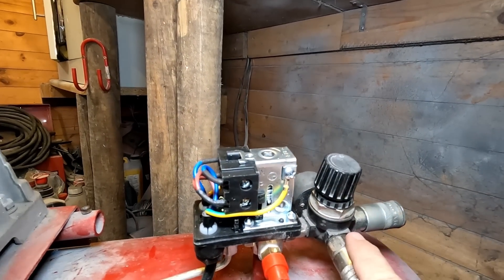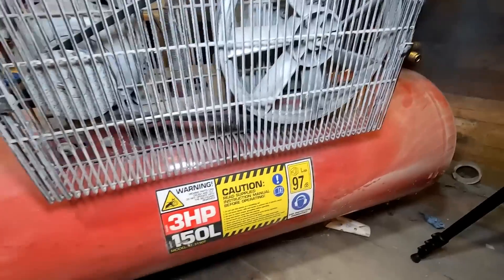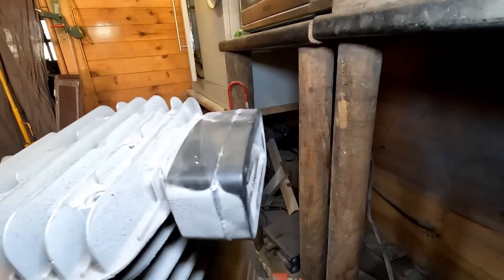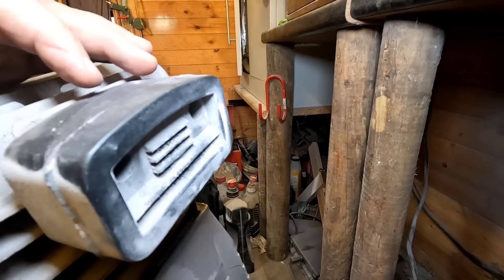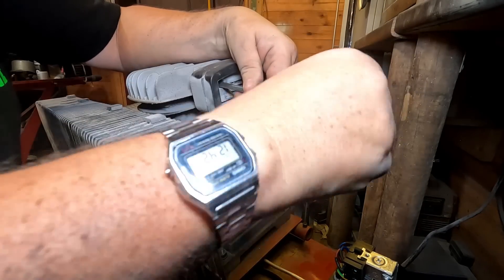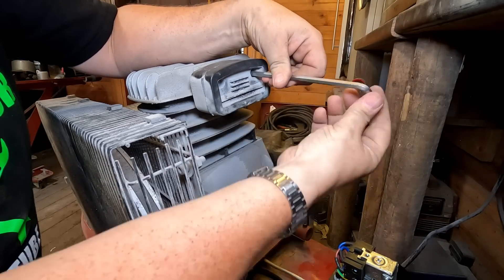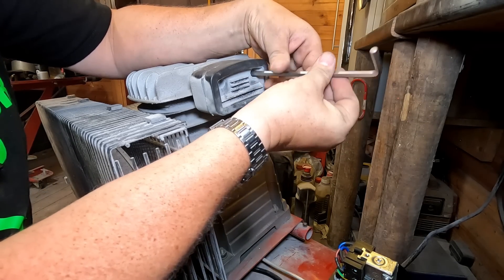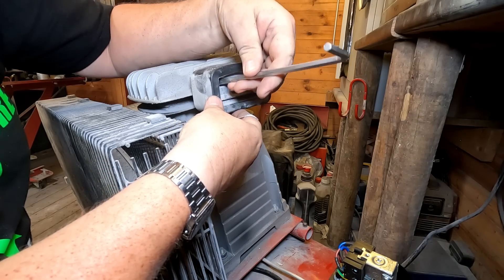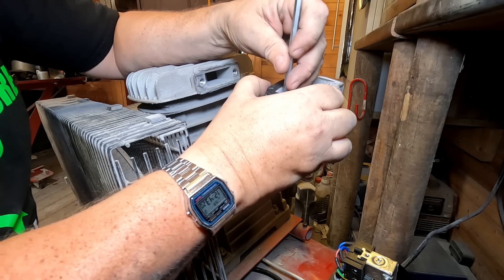Everything's on and tight. There's your pressure release valve — you can just pull it to do a little test on it. I'm going to have to get another wheel, so I'll take that inside because they do different sizes. Now, while I'm here, this is where the air filter lives inside this little cover. I thought it'd be a good idea to check this as well, bearing in mind the amount of dust that's around here. It's held in by a 6 mm Allen bolt. You should check the sponge air filter periodically, folks — if it ain't sucking air in, it ain't putting out.